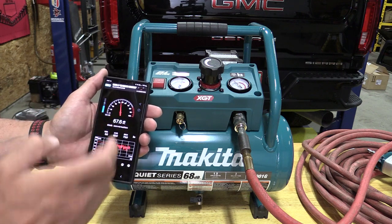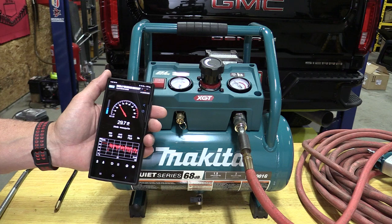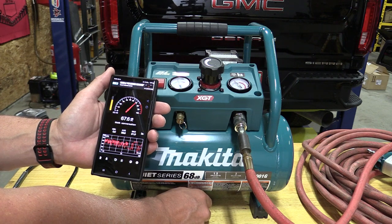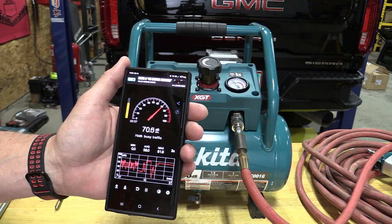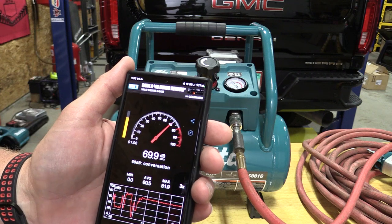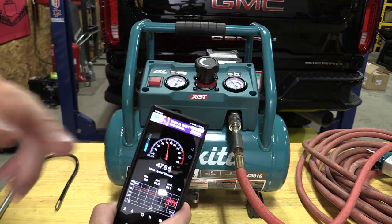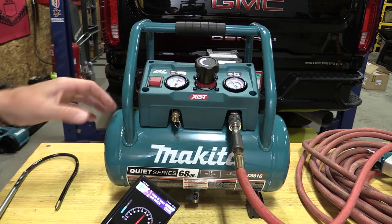We're gonna watch the decibel meter here and just see what's going on. Again, we have a small leak in this, which is on my end, because it's at this swivel. So you can see me slowly getting closer to the camera there, and it came down into the 60s the further I got away. We are 18 inches away from this unit with the camera, so it's going to meet about its 68 decibels once you get to about 3 feet away from this.